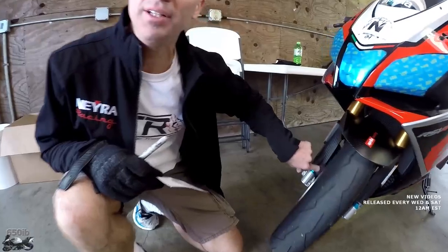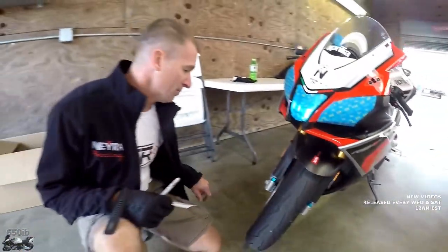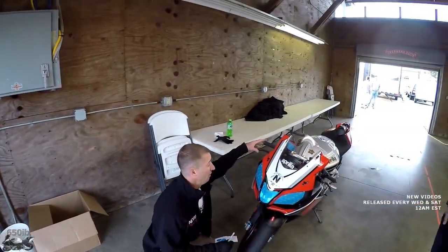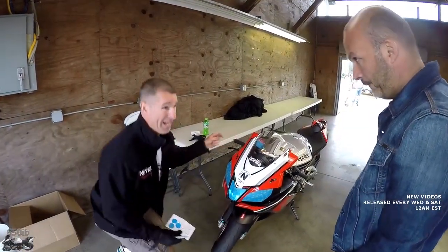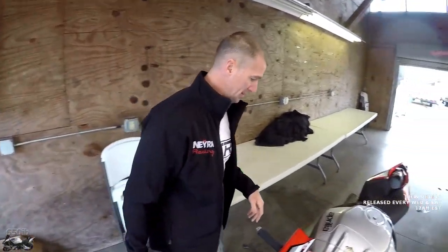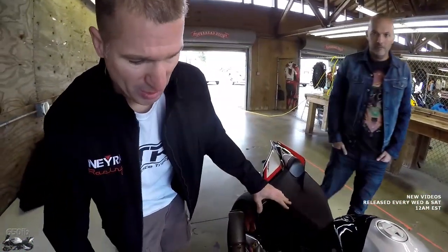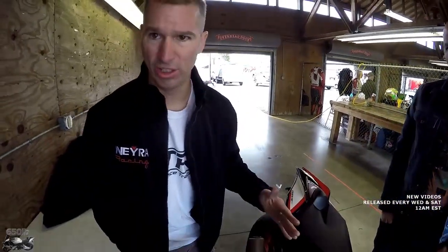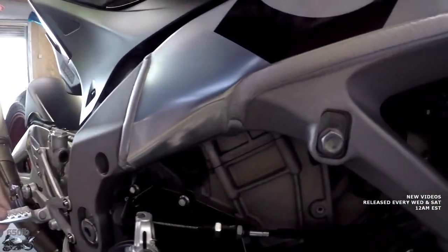There's plenty of pad left on the rotor, on the brake caliper, I'm sorry. After a while the pads get too thin, they don't dissipate the heat properly, and the brakes fade really bad. We don't really check too much because the level of tech is a little lower than the regular brakes, intermediate and advanced. But he's got safety wire, which is great.